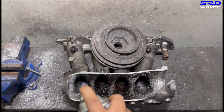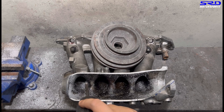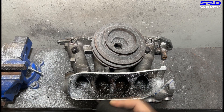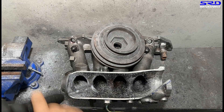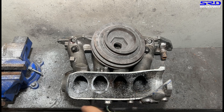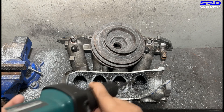We're spraying with WD-40 for now because there's a bit of carbon so it doesn't smear around — we just carve it with a carbide cleanly. So we start with a carbide, and we time-lapse so it doesn't get too boring. We start with the opening because it gives me a guide of how the entry is going to be before we start working on the runners. You can do it any other way, but this is what's consistent for me.